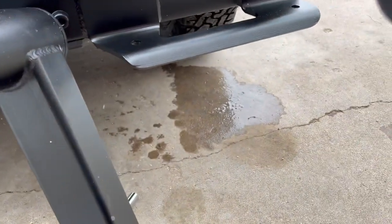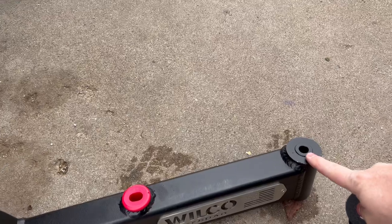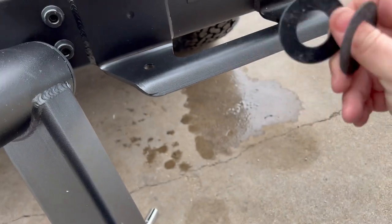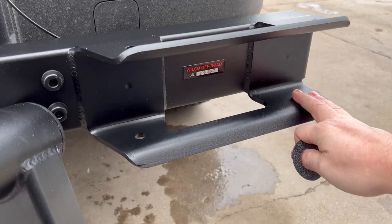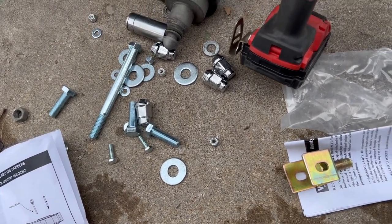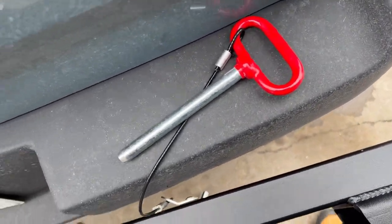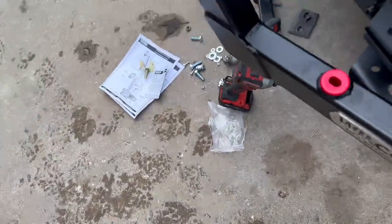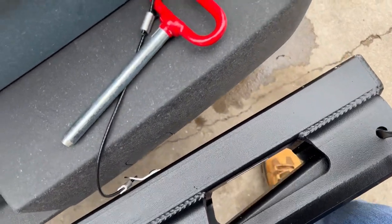As you're putting this together — this piece here is the pin with the bushing. This is the swing arm that goes right here on the end. You're going to see two of these plastic washers — they go on here to help space it and give it the clearance it needs. Then you've got the big bolt with the washers and the lock nut. Once you get this in, it's going to be very hard to get it moved around with those washers in place. I'm finding that a screwdriver works really well to try to get it positioned super close.